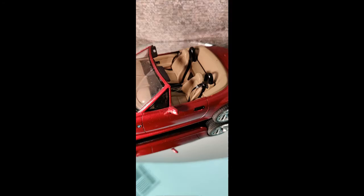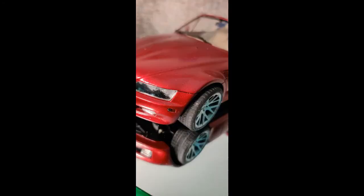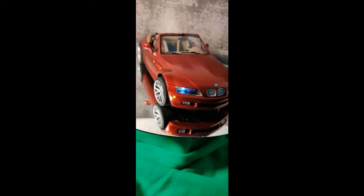I should have gone with Pico LEDs all around instead of just the side lights. This would have reduced the LED size as well as the wiring thickness. Also, the battery is not powerful enough for the lighting even though I drastically reduced the current driving the headlights — it still puts too much load on the battery. I think I would select an ATtiny84 with more I/O lines and then use the trunk area for a larger battery source.